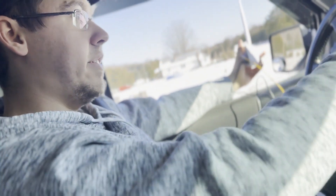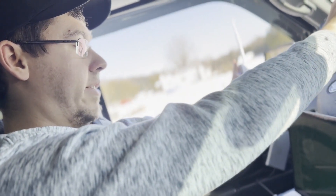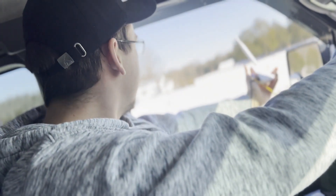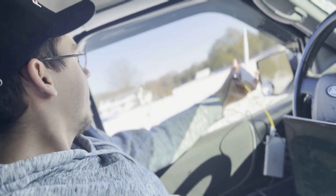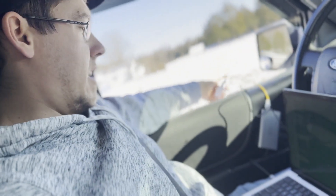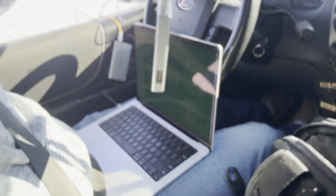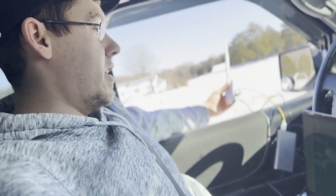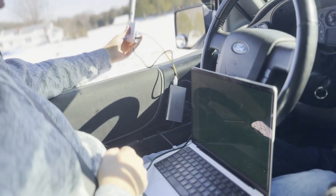I'm going to try and pull back here and see if we can get the speed test to pass. Let's pull out the SDR as well and see what the SDR sees. I would like to do a speed test. The fact that it even links up at all is impressive. Mind you, this is also completely Layer 2 — it's literally just acting as a Layer 2 bridge. On the other side of this, it's plugged into a switch and it only learns one MAC address, which is going to be my USB NIC. To the switch that it's connected to, it's completely transparent — it has no idea what's on the other side, other than a laptop or USB NIC.